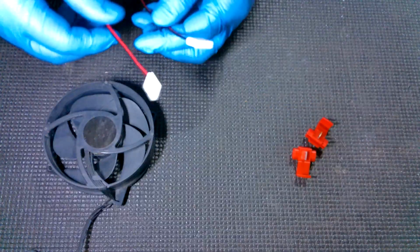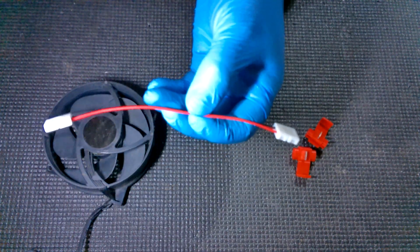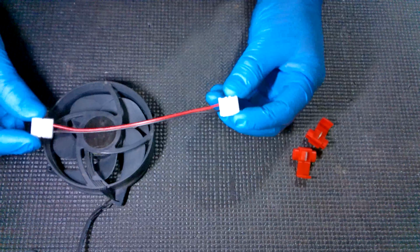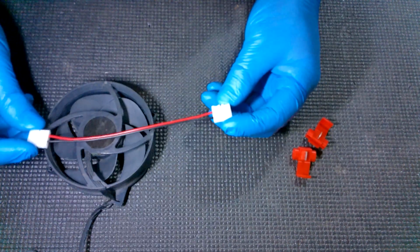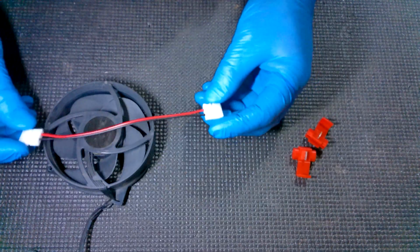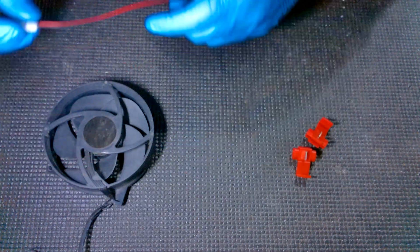The next thing is we've got our actual LED connectors. You're only going to need one of them, but the problem is that you can only buy these in quantities of at least 10 to 20 sometimes. These are just LED connectors for, again, 10 millimeter. Don't get the 8 millimeter. 10 millimeter, and they are also the type that's used for non-waterproof. There are some for waterproof. They look way different than this. So these are the ones you want to make sure you get.